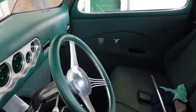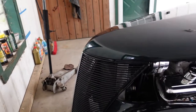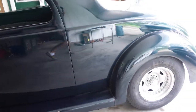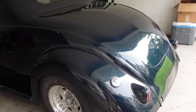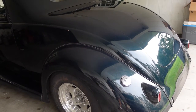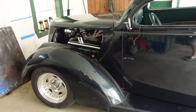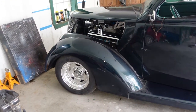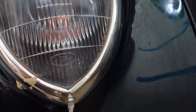I'll take a few pictures here and there. I don't think it's gonna be terribly interesting, just to show what the inside of these buckets look like. Wiring gets real difficult on a fiberglass car like this because finding good grounds is tough. I've had issues with the brake lights and turn signals just not being grounded well and I've had to move those around a lot. I attempted to run a new wire right to the battery ground for the lighting system because of that — they work good now. But the running lights keep popping a fuse so something's wrong. I've also never taken these front lights off, and I just noticed they use old-school flat head screws.